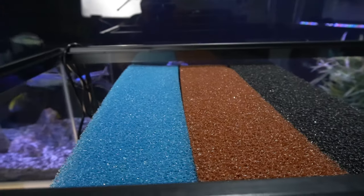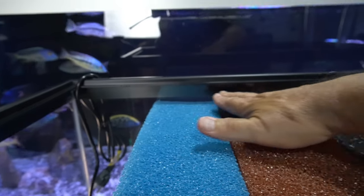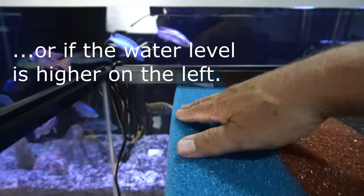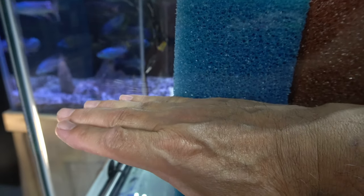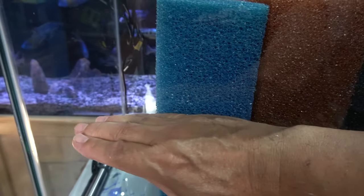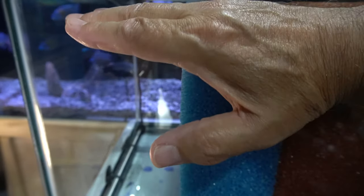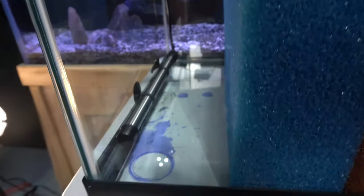There's really no need to mess with the sponges unless they're blocked. You'll know they're blocked if the water is flowing over them — there are several inches of space on top right in here. If the water ever starts to flow over them, you know there's blockage. But the water level will more than likely stay right here at all times, and when the pump is turned off the tank drains a bit, it'll come up to within an inch or two of the top, giving a safe margin.